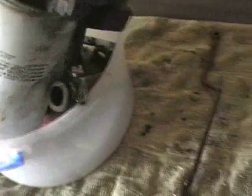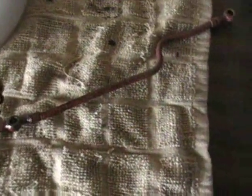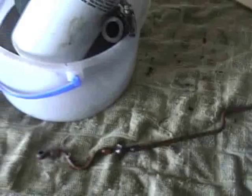One other quick thing — here is the fuel primer pump; it all feels like it works. The fuel filter is on the motor. One thing I wanted to mention: this is one of the fuel lines, and it has these little screws with holes in them that supply fuel to the injectors. I know for a fact that I am missing one of those screws — you'll need to get one. From Torrance Marine they're not expensive at all, like three bucks or something. So for a marine piece that's not too bad, and I believe with that and some maintenance you'd have this motor in good shape.